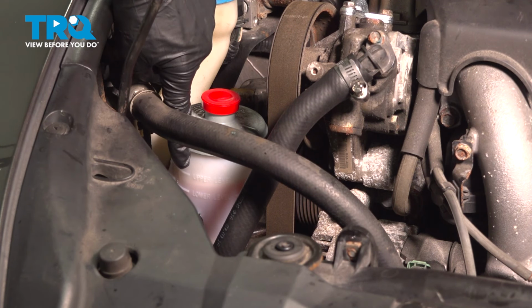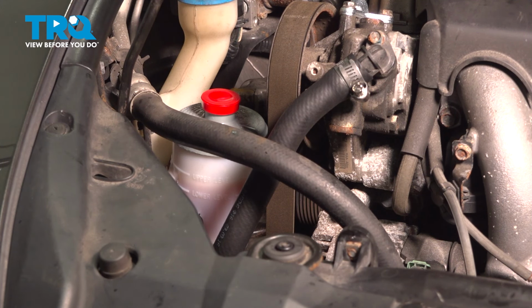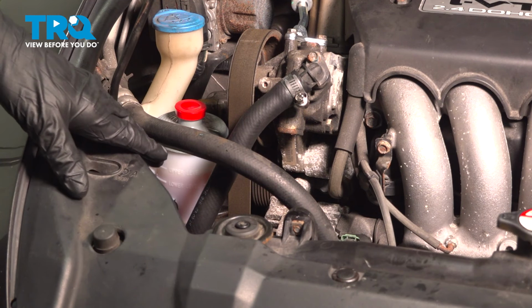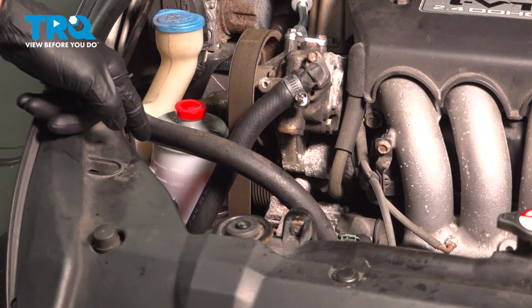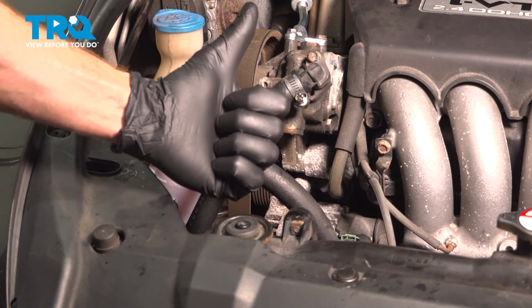Let's check that power steering level. It's right in between the 2 markings there. Now we can go ahead and start up the vehicle, let it run, and make sure we don't have any fluid leaks. Now once you've run the vehicle, you found that you didn't have any more air in the system, and you checked for leaks, go ahead and take your vehicle for a road test. Thanks for watching.